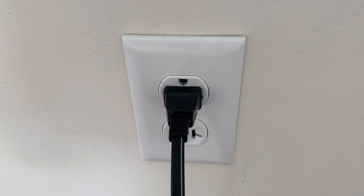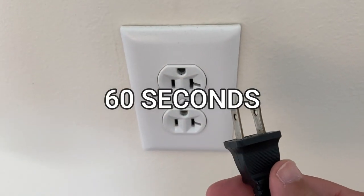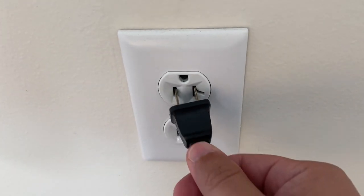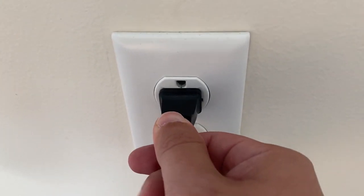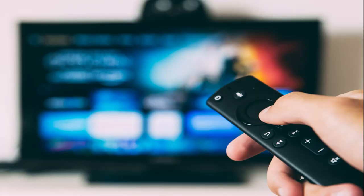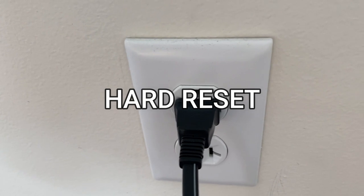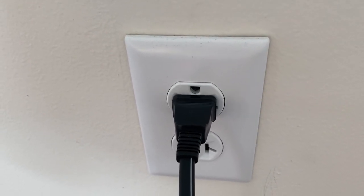The first method, and it's probably the easiest one to try, is to unplug your TV from the wall outlet and wait 60 seconds. Don't be impatient — wait the whole 60 seconds and then plug it back in. This is very different from turning your TV on and off with your remote control. This is what we call a hard reset of your TV, so make sure you try this method.